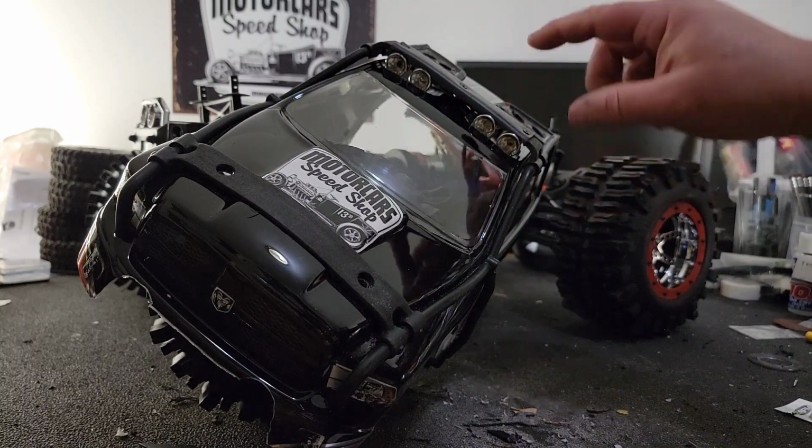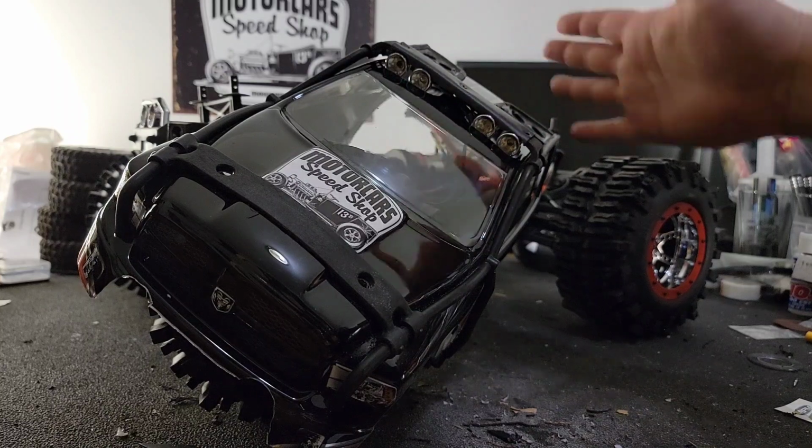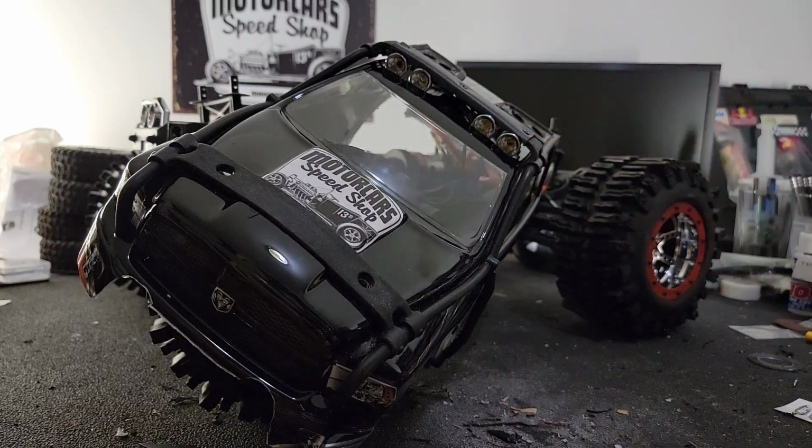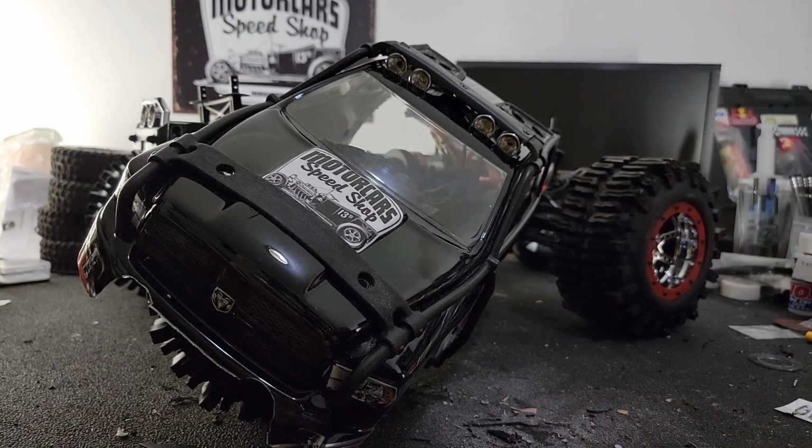That didn't look right, so I went ahead and took a piece of ABS plastic and sectioned it over the top, melted it down to where it would fit a lot smoother, and bolted it in to make this way more solid than it was. I wanted to give it the structural rigidity it had from the old bodywork, and make sure this thing went on its lid without just snapping the glued-in parts apart. This won't come apart now.